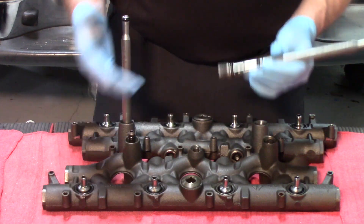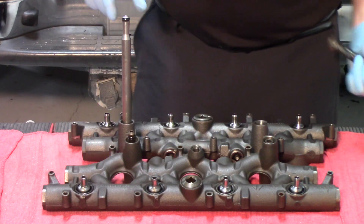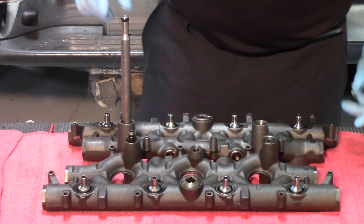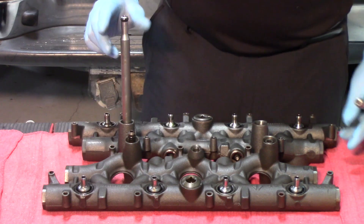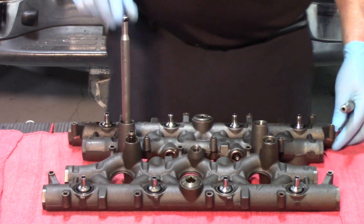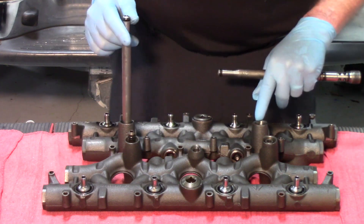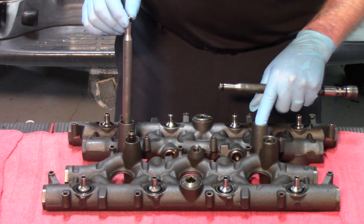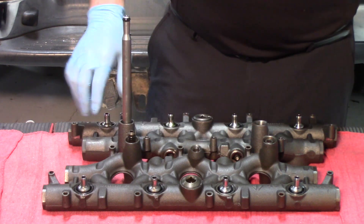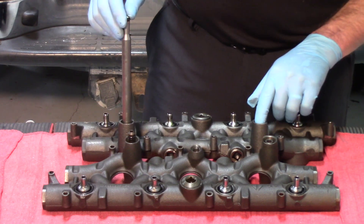In order to get that oil from the high-pressure oil pump to the manifold, it comes through what are called standpipes. We have two manifolds here — the manifolds are the same left and right — however, when you put one on the right, you've got this standpipe that's going to be in a different position, so therefore we have a blank hole that needs to be filled, and that's where the dummy plug comes from. On this manifold you're seeing it removed with the standpipe in place and the dummy plug.